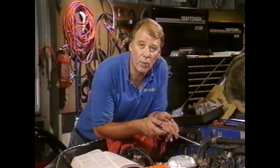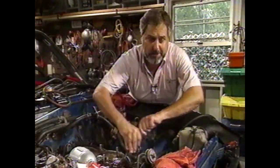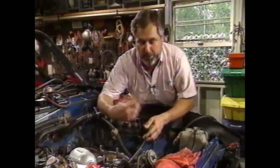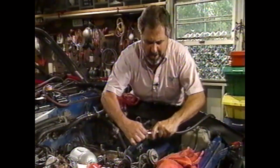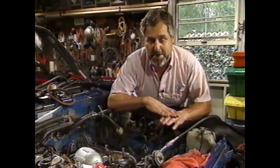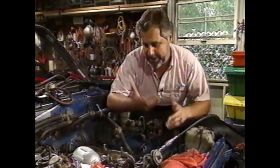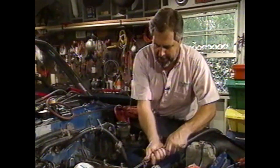Now we fill the cylinder with compressed air to hold up the valve. You want to have the piston up in the cylinder — you don't have to worry about what stroke it's on since the rocker arms are off and both valves are closed, so the cylinder is perfectly sealed. If you should break an airline and the valve falls when the spring is off, the valve will hit the piston and you won't lose it. If the piston is down, you defeat the purpose — you'd have to take the head off.